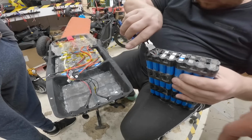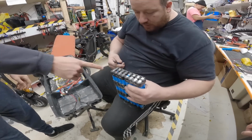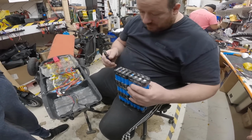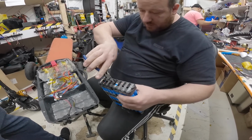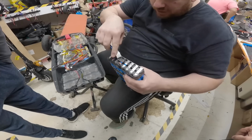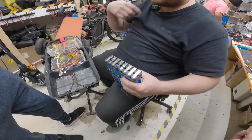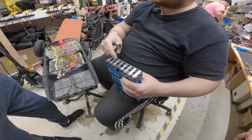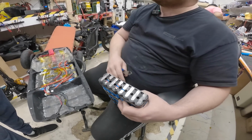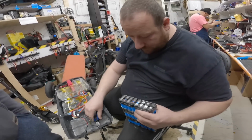Oh my god. So the discoloration in here is the burning, right? Burning of the nickel or the cells? Nickel, but it also starts affecting the cell. If you keep using this battery, you see this protection here? This protection starts burning out. Oh shit, that's bad. If you keep doing it this way, it will burn the whole thing and the battery will catch fire, because you're gonna make a short circuit between positive and negative. So it was about time. It's gonna happen soon.